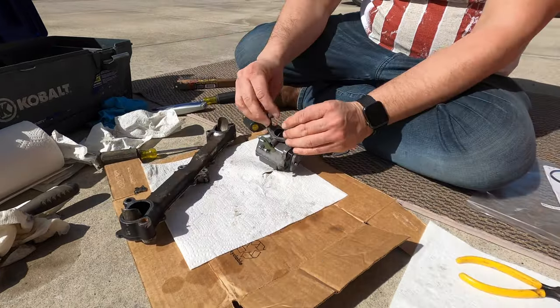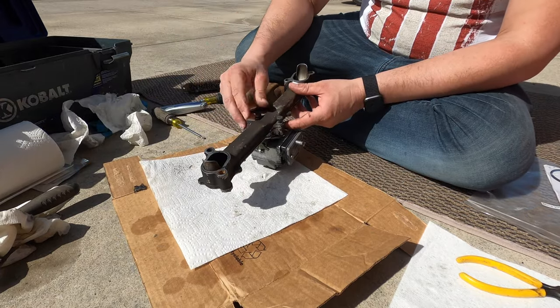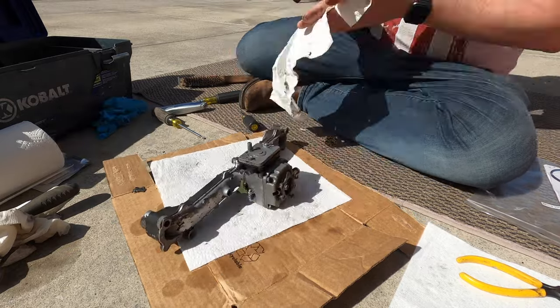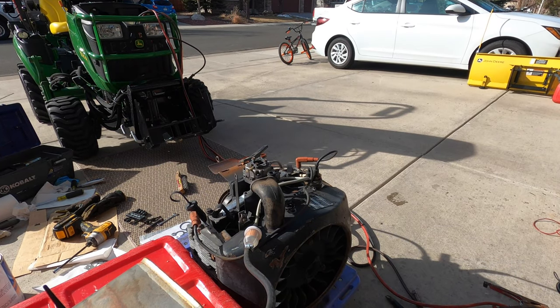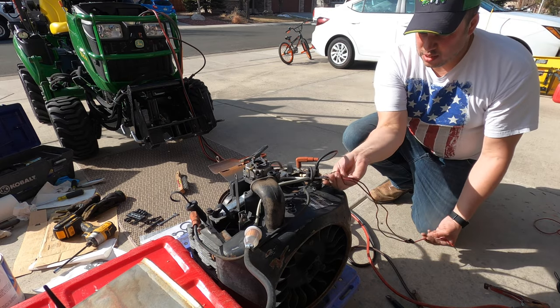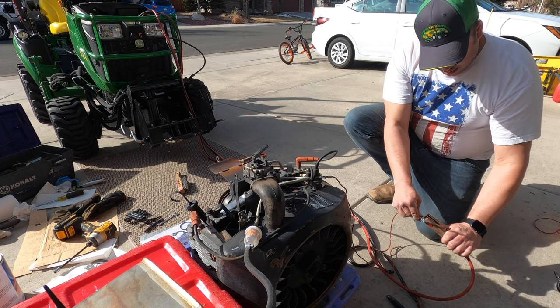One accurate reminder: when you reinstall the carburetor, attach it to the manifold before you attach the manifold to the rest of the engine. You'll want to use new gaskets when you attach the manifold. I've already done that and now we're going to try to give this thing its first start. To do a test start, you need to give the coil 12 volts and obviously give the starter 12 volts.